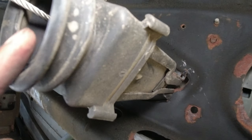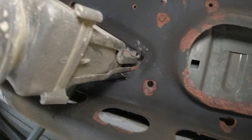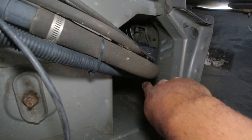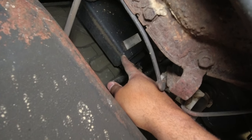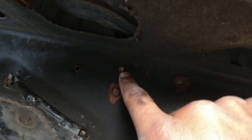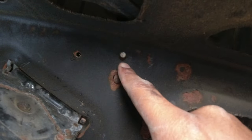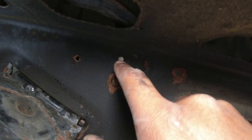You have your spare tire holder — this is towards the back of the truck, this is towards the front. Here you have the evap canister. You have one line that goes up to your filler neck and then the line that goes to the evap box right there. This is the bolt that attaches this to the body. I believe this is a 13 millimeter.